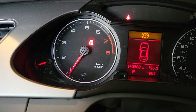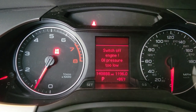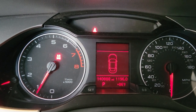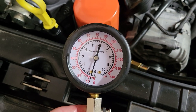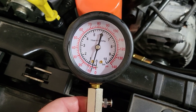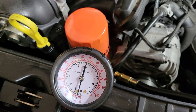The car had been running. I drove it down the road to make sure we've got good temperature. The switch is out and the mechanical gauge is plugged in, that's why we got a reading immediately. We're looking at half a bar — about 8 psi. Let's swap out the filter and see what happens.